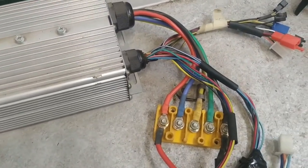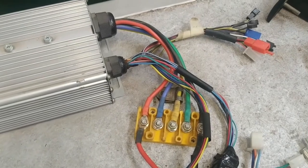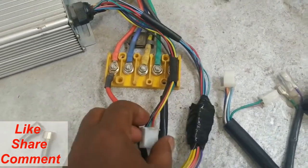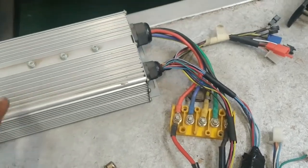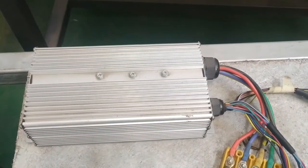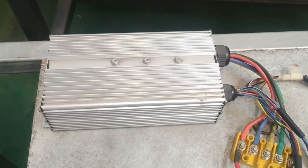These are the power outputs and the main connections. We have three lines going to the brushless DC motor. The other two are power supply lines. These are signal lines coming from the accelerator switch, and these are lines going to the brushless DC motor hall sensor. So this is the speed controller — this is the one that is controlling the speed of the electric rickshaw. The electric signal from this controller directly goes to the brushless DC motor, which in our case is installed on the rear axle.